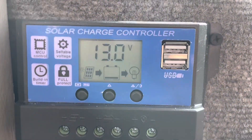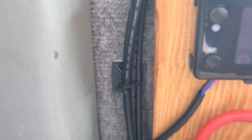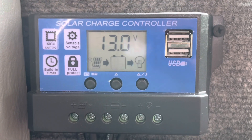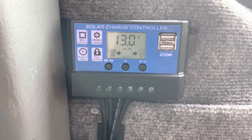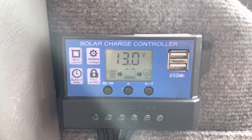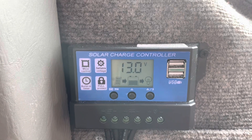So we're the next day now. The panel's charging slowly but it's still partially covered. I've run the cables and covered up where they went — they've gone through the side panel where the seat belt goes and hit the bottom, secured with clips so they shouldn't jiggle about. At the moment it's trickling in. I'm going to take the cover off now and see if it makes a difference. Cover's off, sun's coming out, we're still on 13 volts but it's just creeping up to 13.1. I'll check again in an hour or so.